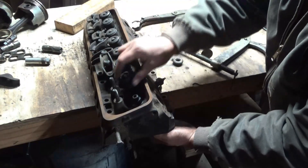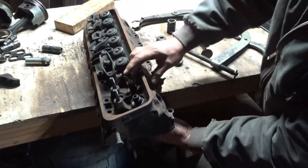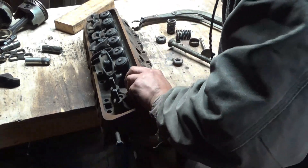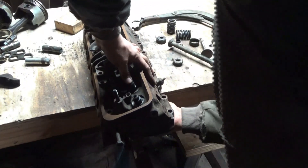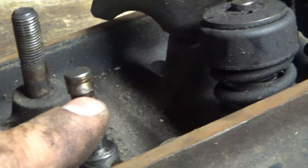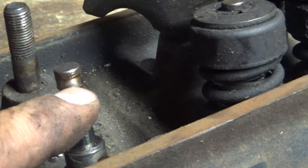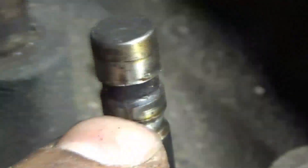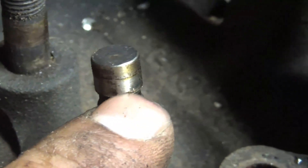You can take this stuff off, take the spring off, now you can drop the valve down through there — or not, it's stuck. The valve is stuck because it has some kind of wear mark right here — it has a little... I don't even know what you call that, but that's why it's stuck. Instead of forcing it through, I'm going to take a Dremel and polish that off, because trying to drive it through there is just going to be a problem — you'll probably really get stuck.